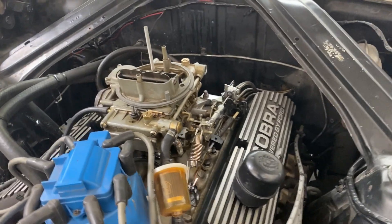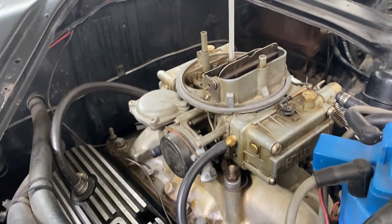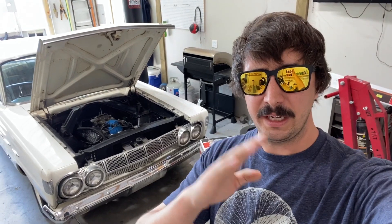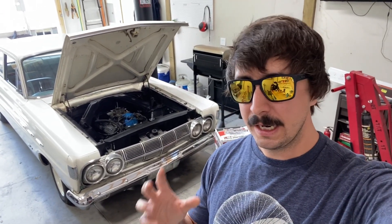You could rebuild this carburetor and it probably wouldn't be a terrible idea. I think it's probably a well-sized carburetor for this very stock mild 302. But in the future I'll probably want more horsepower and that 450 Holley is not going to cut it. A lot of people out there love Holley carburetors, and I personally have no issue with Holley, but I do have a bit more experience tuning Edelbrocks. My experience is that Holleys perform extremely well, especially on a dyno or a racetrack where you're going wide open throttle. But for around-town drivability on a cruiser, I think the Edelbrock may have a little bit of advantage.